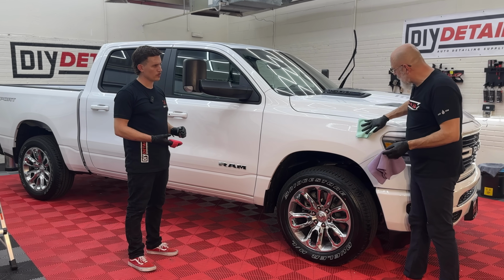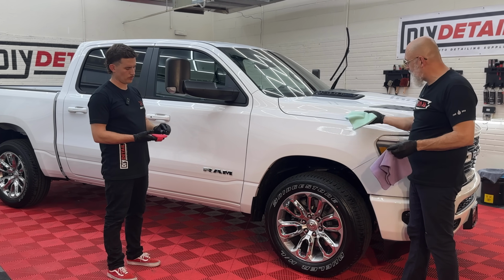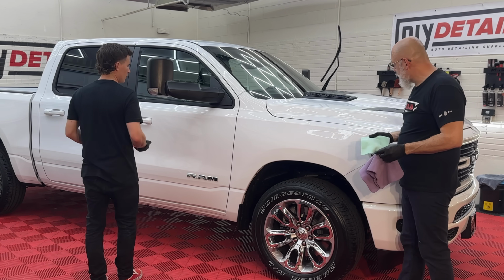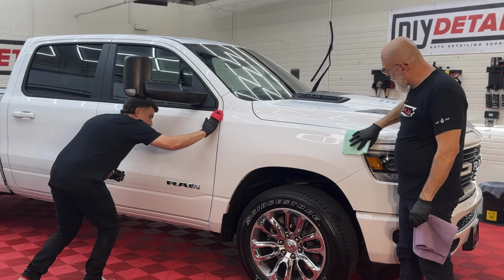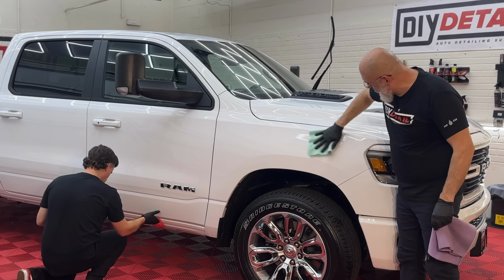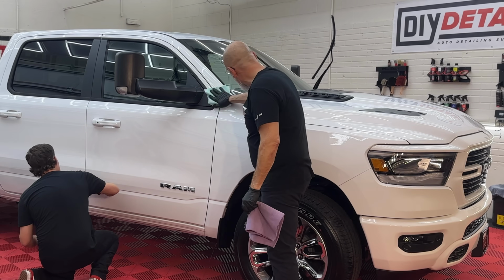And if it feels like I'm moving liquid, I stop. I'm not ready yet. And I'm not ready yet. So you're not ready? No. So we'll leave it another 30 seconds or so. You can do the next panel. Okay. And then I'll try another section. Oh, there we go. So now it's feeling slick. I'm not feeling like I'm moving any liquid around, so I can wipe this panel off.